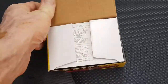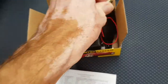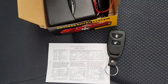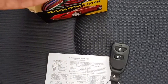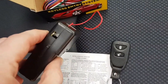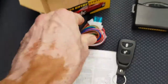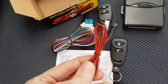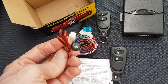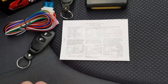These come in various types; this is quite a simple one. The fob just has lock and unlock — it doesn't have the rear boot button because that's not supported by this car. You basically get the control module with its main connector, jumpers controlling some of the functionality, a spare key fob, and an LED which can be used as a visual deterrent when the car is locked.